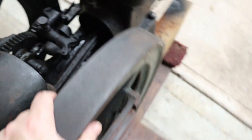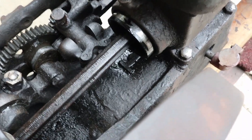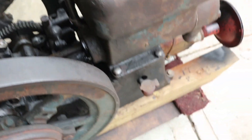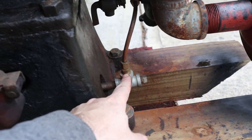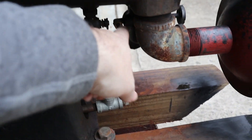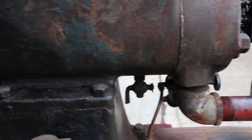It's pretty cool how past the compression, on the backstroke, the piston comes all the way out of the cylinder a little bit and then goes back in. The little gas tank is in the base — there's just a little flap for the gas tank. And there's a little check valve, so the gas gets sucked up into the carburetor but doesn't flow all the way back. There's fuel in the line ready to be sucked in by the carburetor. And this little petcock is the drain for the water hopper.